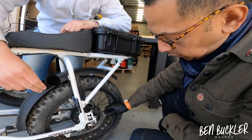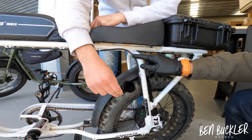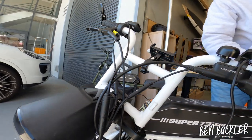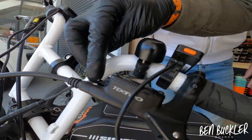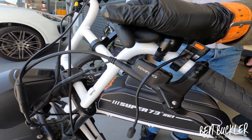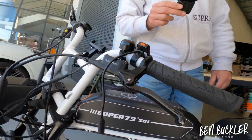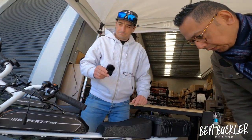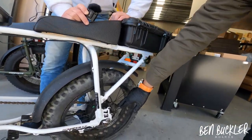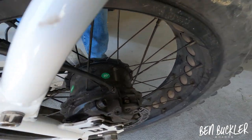Go down to the disc, make sure it's all dry and there's no oil there, then work your way up. Make sure there are no oil leaks all the way through, and then come up to the actual reservoir. Make sure the connections are all solid and there's no oil. If that looks good, everything is safe. The other thing to check would be the actual brake pads — we'll probably change those just to make sure.